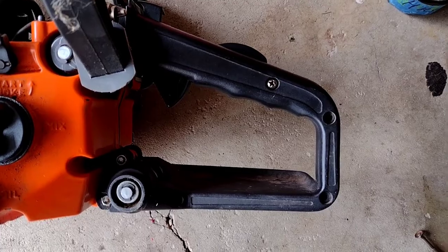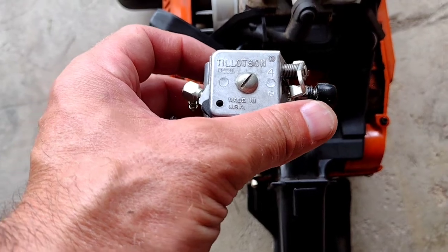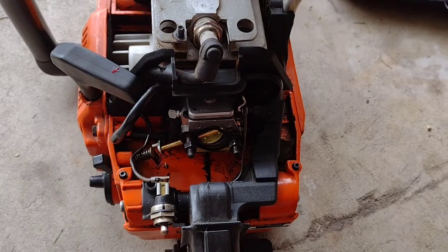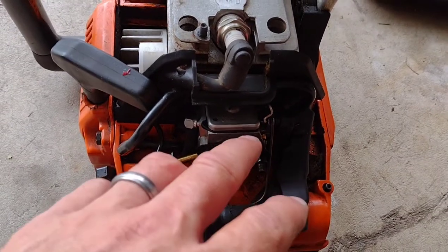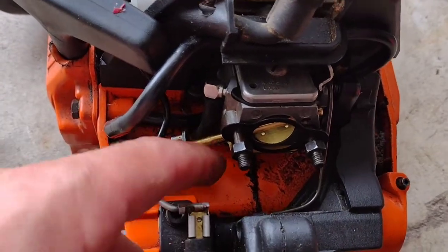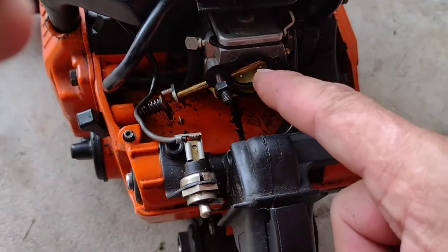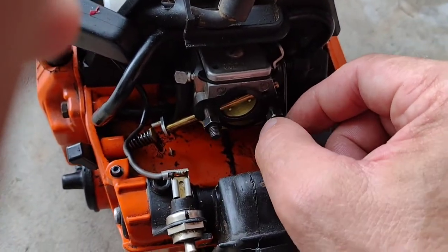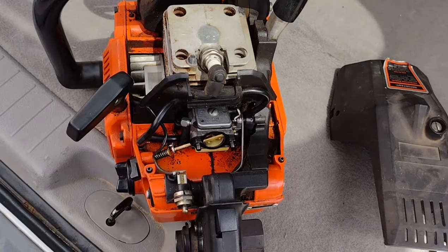I compressed it, kept it off the center pin just enough so I could squeeze on the other side to pull that pin through and attach the E-clip. Then I can go ahead and put the rest of the screws in. The first thing I'm going to do is attach my throttle linkage into the little hole here, rotate it so it fits properly, then stick the bolts back on either side. You just have to tilt the carburetor to get the throttle linkage up in there. I ran my fuel line up — that's attached. Remember the gasket is on there.